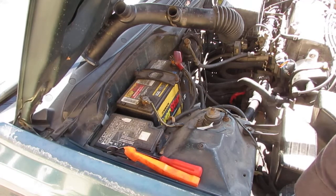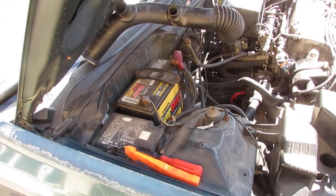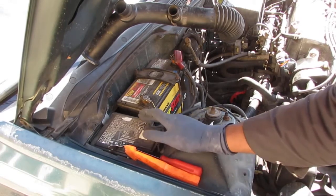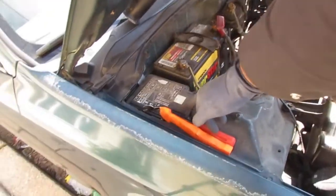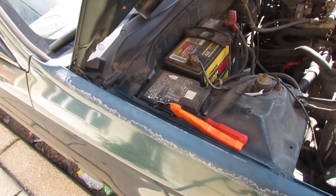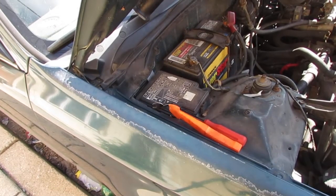What if the clutch switch could have failed? Something's preventing it from getting a signal. You know what? Let's look at the wiring diagram and see what fuses are in place for the starter. Yeah. Let's see that, because we have a fuse box here. We have a fuse box underneath. Let's just check and see if all those fuses and relays are in place and functional.